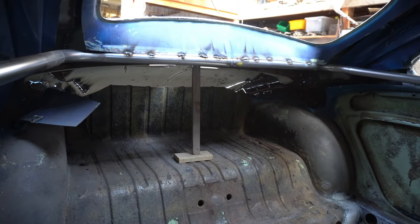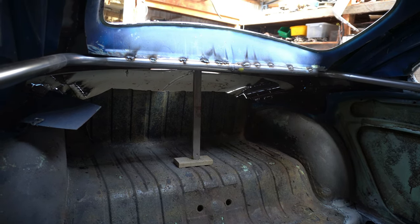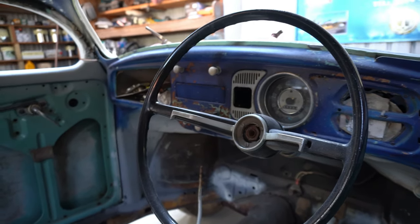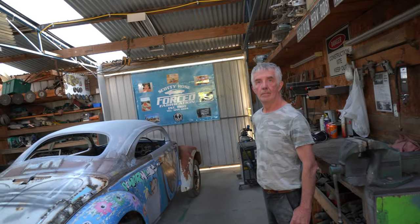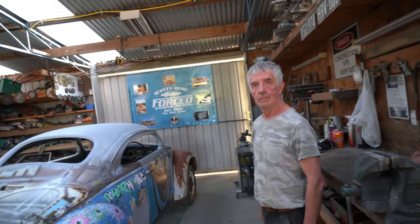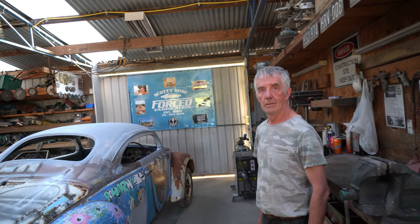With any of these conversions there's always a bit of messing around to get the cooling right — move the firewall forward and that's where you'll put the radiator. The radiator's going to be sitting above the gearbox behind there. As you can see she is a bit Flintstones at the moment but it's nice to have the floor pans missing so you can at least roll the car around while you're doing work on it. It is an adapter plate from the engine to the standard gearbox, so it bolts straight on, which is pretty sensible. The clutch of course works straight on the original gearbox and the accelerator cable must link up well enough because other people have done it before — hopefully that's the easiest part.